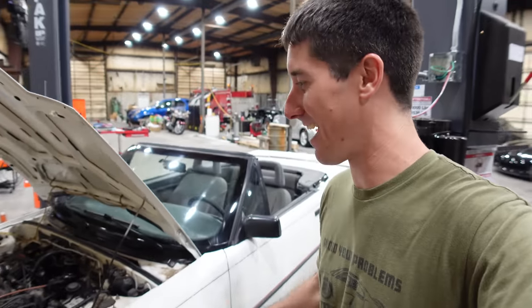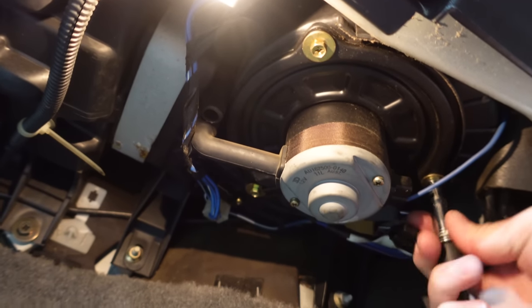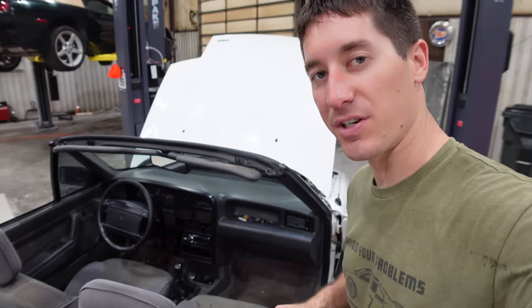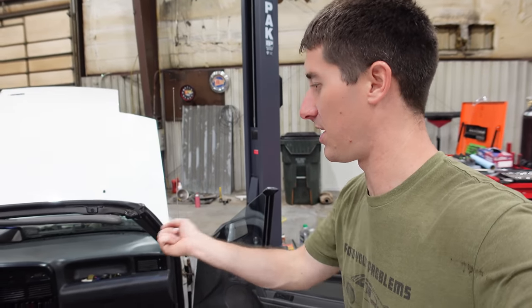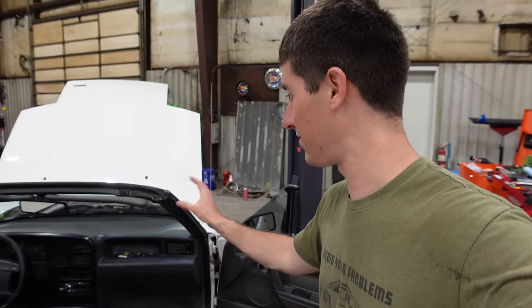Let's get the leaves out of the blower motor — that's got to happen. I want to be able to use the climate without getting blasted in the face by pieces of leaves. Starting with the blower motor, because that should be the most trivial thing on the XR2. There are actually floorboard lights, which is fancy. There's the blower motor — looks like three-eighths. I grabbed a socket and it is three-eighths, so I'll zip those out with the impact and see what comes out. Leaves. Lots of them. My plan to tackle the leaf infestation: start by vacuuming with the shop vac, get every loose leaf I can, then take the air compressor and the Milwaukee blower and just blast it as hard as possible through all the vents and the blower motor hole. Hopefully that gets it all out and gets the HVAC system cleaned.